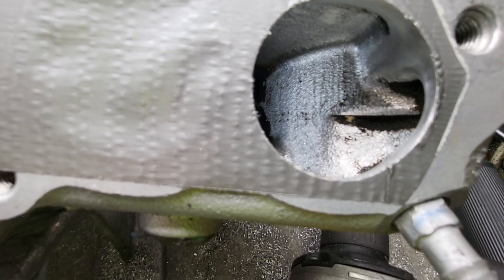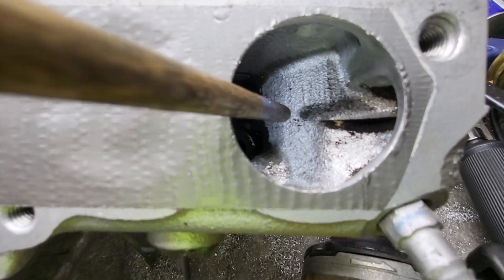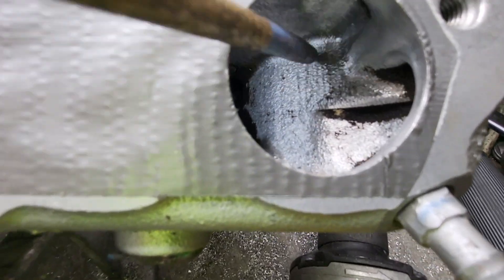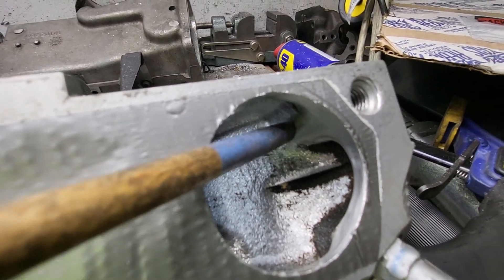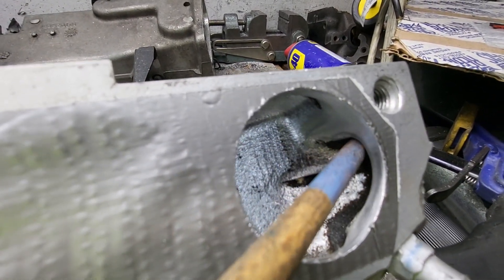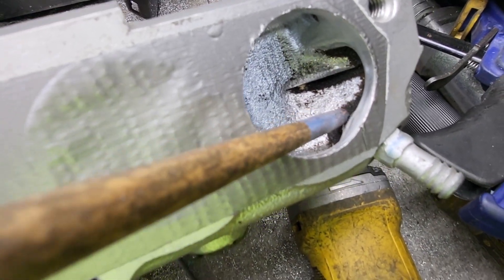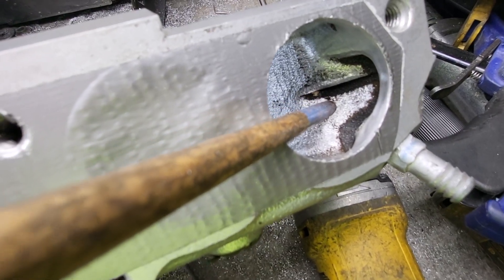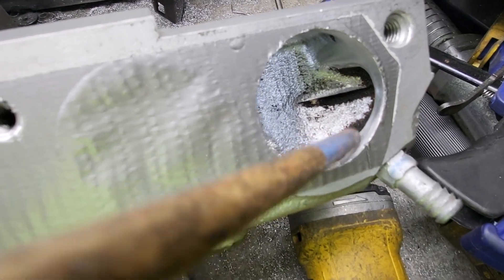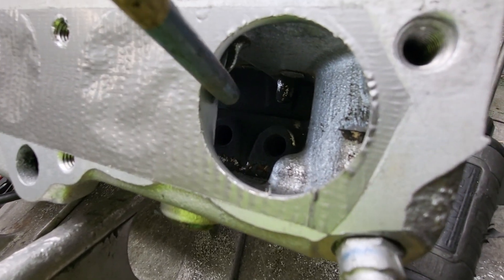Alright guys, this is what we've got. You can see in some spots I didn't really take off a lot — I can take off more metal out of this back wall here. I could take more metal out of this, but that wall was actually curved the wrong way; it'd be nice if it curved the other way, but it doesn't. We've got a big bolt boss here — a lot of metal can be taken out of here. I took out a lot already because that ruins the radius coming into this runner. And then we have this vacuum port — the stock vacuum port stuck out all the way out to here; I'm machining that down, no reason to have it that long. Trying to give it some kind of a radius coming out.